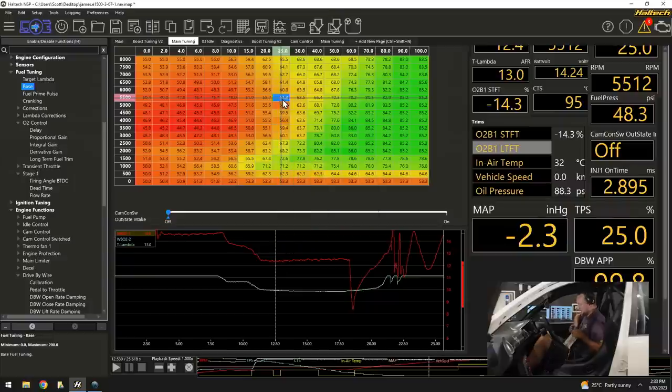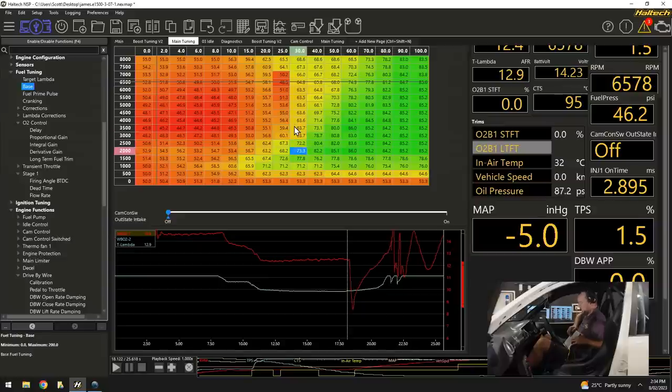14%. It's always a nice idea to do percentages rather than actual values or pressing ups or downs, because you often don't end up keeping the same shape of the map, and that is a bit of an issue. So now we can look at that shape here and say, okay, well, the number to the left of that can't be higher. That doesn't really make any sense. So I'm going to come back here and I'm going to smooth that all in. Copy that one all the way up, and that seems probably realistic.